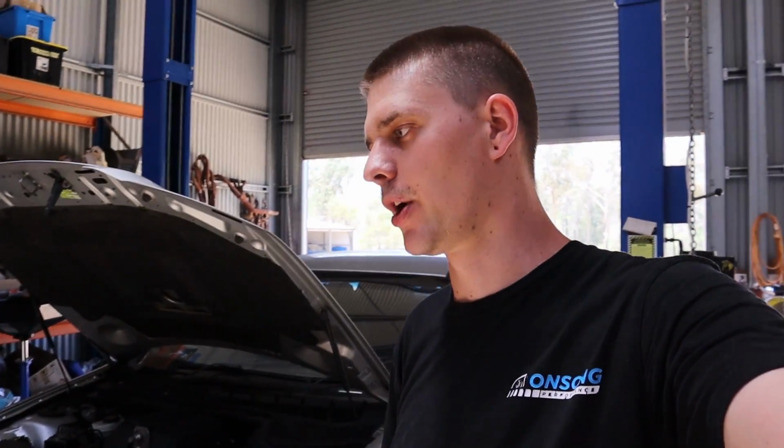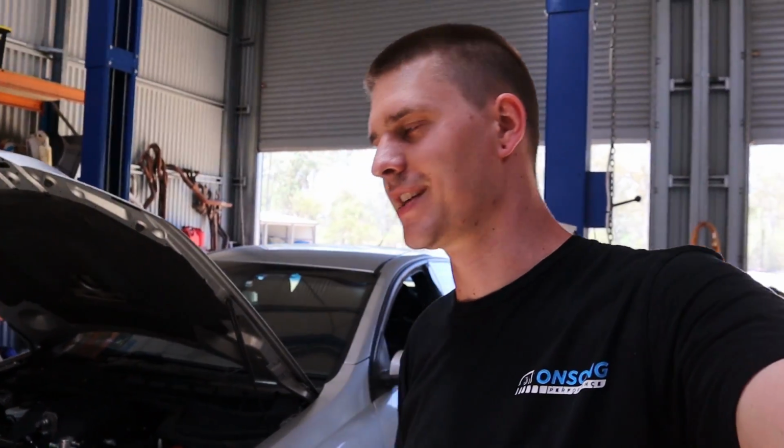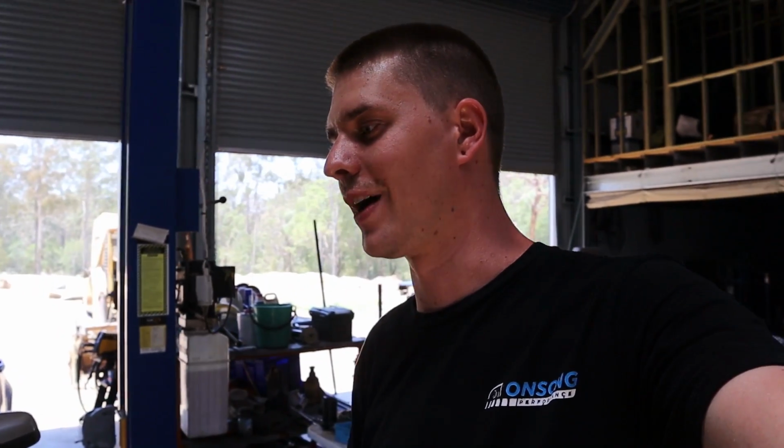It could have just been unlucky. They might have just been unlucky. Something else could happen. You never really know. Whenever we get advice like this, we always take it on board, but we don't take it as gospel, because every setup's different and you never know what could have happened. Either way, we're going to take that into account for sure. So we're going to chuck in a fuel pressure sensor and keep a really good eye on this while it's on the dyno, and for the initial fair bit of abuse that this thing's going to get, we're going to keep an eye on that fuel pressure.